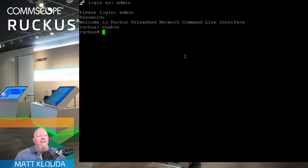And one thing I will recommend is if you have old legacy devices in your house, if you have anything that's running at 802.11b, don't do this. If you no longer have anything that is 802.11b, you can do this. Now, I will caution you on this.